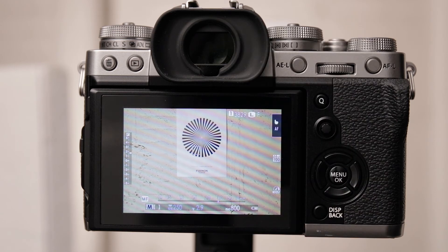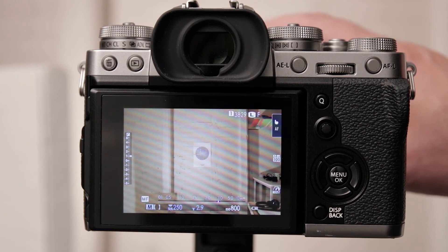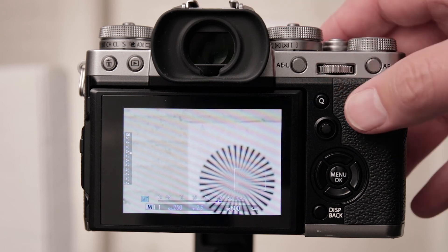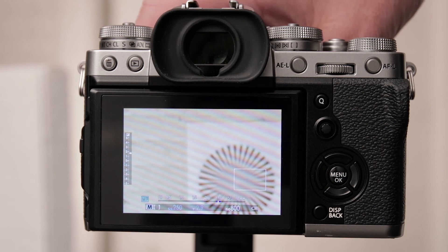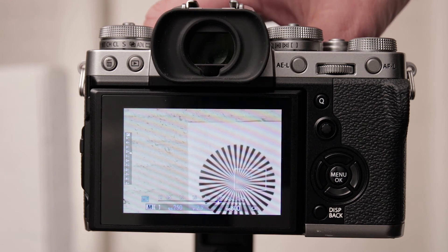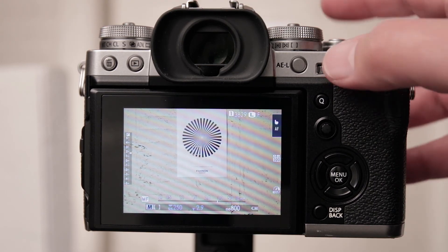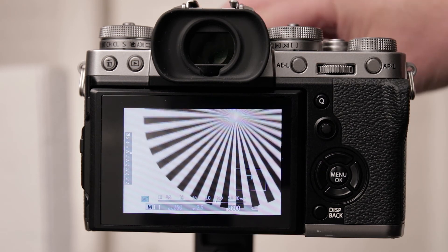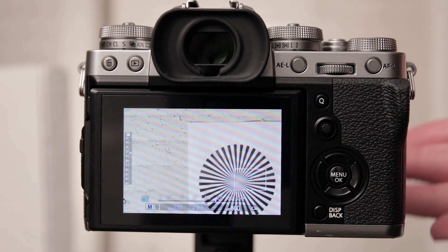Slap it on the wall, have your camera about three meters away, and zoom out. If you struggle to see what you're doing, you can use your focus assist. Try and focus it using only the flange focus ring, making sure the iris or aperture is wide open. Then zoom in all the way, refocus, and try to get it as sharp as you can with the focus ring. Then simply zoom out and check if it's still in focus.